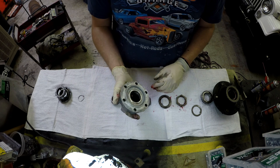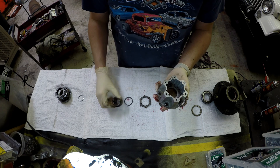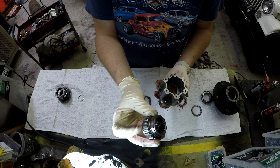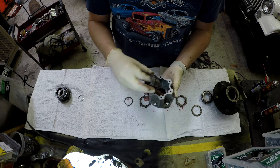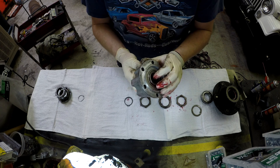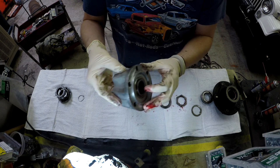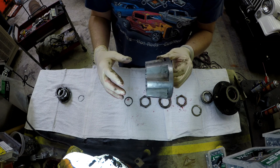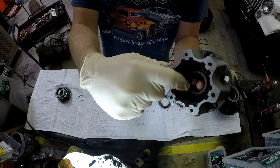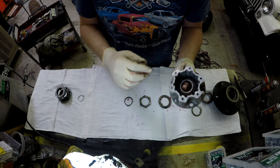Here we have a standard snap ring. And now we're actually seeing the hub — this is where the proverbial magic happens. The hub is the part that the dial bolts into. And here I am holding what's called a hub shaft. That hub shaft is what goes onto the splines running through the constant velocity joint off the front differential. This is where power is transferred to the assembly. When we bolt this all together, the only thing making contact with the constant velocity joint from your front differential is that small hub shaft. That hub shaft has sets of teeth — those splines on the inside where it makes contact, and on the outside. That outside set is very important because that's what's going to allow us to transfer power using our dial.